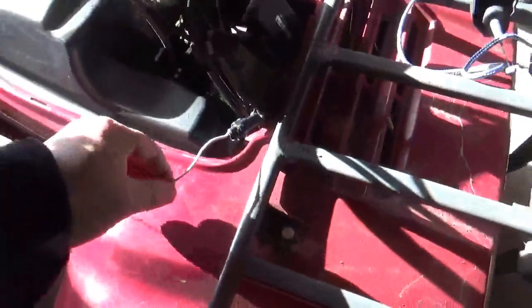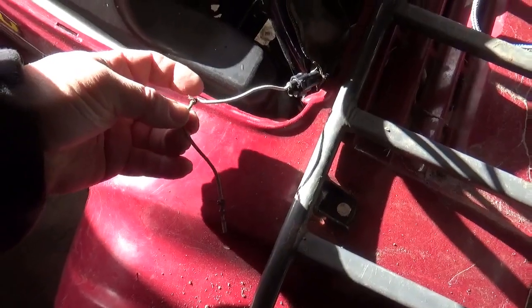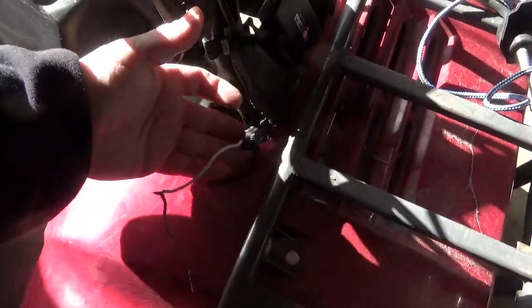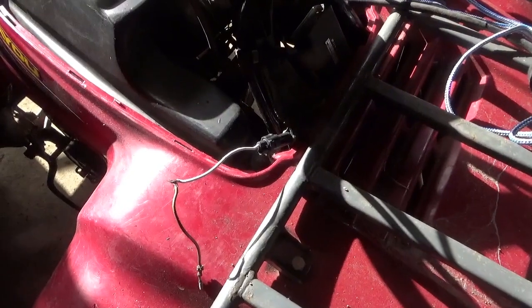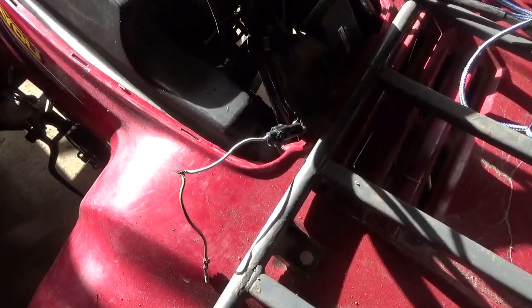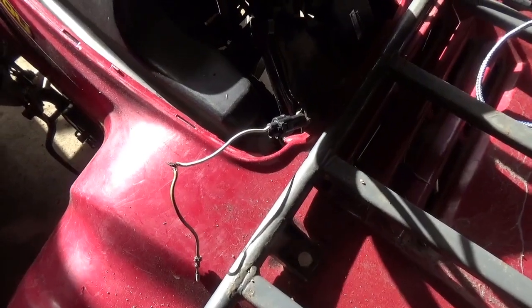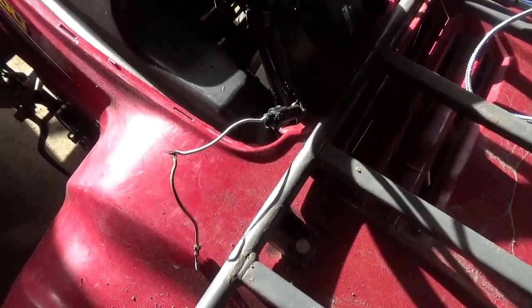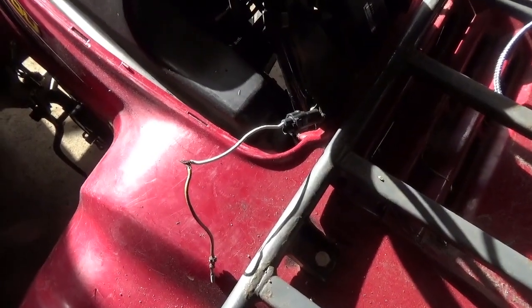You can pretty quickly realize that this is probably how they turn it on and off — they just put these wires together. Given that there are only two wires, you can safely assume that this CDI is powered from the battery, not the flywheel. If it was powered by the flywheel, there'd be four wires up here: two wires to turn the power on and off, and two wires to control the CDI via the kill function.